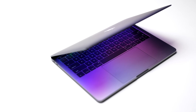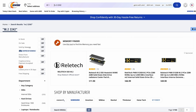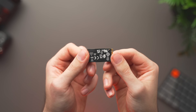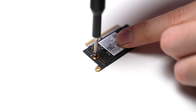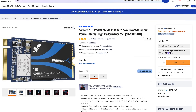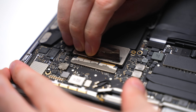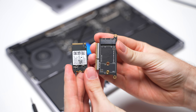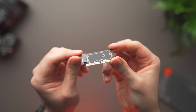I need a couple things before starting this project. First, a new SSD. You can't get just any SSD because it has to actually fit inside the MacBook, so it needs to be a specific size — a 2242 form factor M.2 NVMe to be specific. I decided to go for a super cheap Samsung OEM 512GB drive for about $75 USD. It'll quadruple the storage capacity of my MacBook while keeping costs low. Another option is from Sabrent if you want a drive that's a little bit faster and with larger capacity, but 512GB is plenty for me. Next, I need an adapter because — surprise surprise — Apple uses some weird proprietary connection for the SSD. $20 later, I have my adapter and we can get started. I will link the SSD, adapter, and all the tools I used in the description.